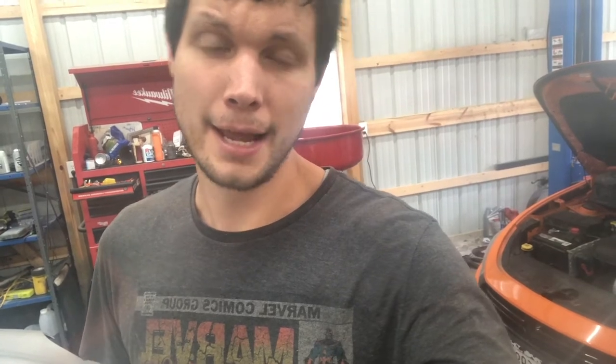This is actually kind of a two-part episode. This is the second time it's come back in here in a week. Originally, I came in and we looked at it. It seemed like the alternator was bad, so we replaced that. But it seems like it has a couple of other electronic gremlins, because it came back to us and it essentially died while running again. Would not start or turn over afterwards. I went and checked it out, pushed the car to get it out of the way, and then immediately it would start again. So something very strange going on there.